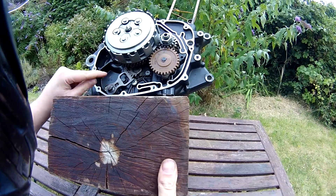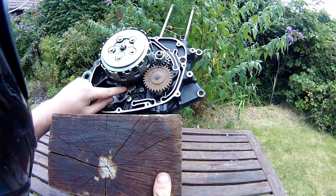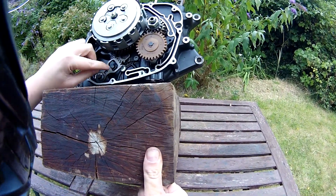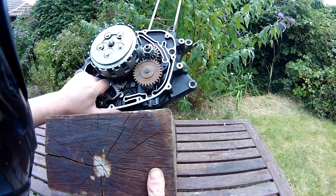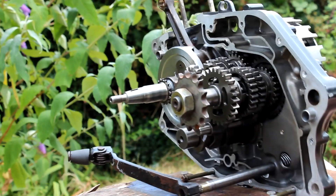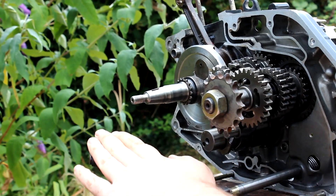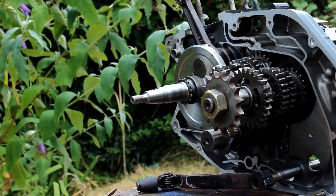The dog clutches catch on to these gears, but we'll get into that in a moment. This here is your shifter — it goes through the engine. It connects to a little ratchet system which makes it only go so far and then return, with a spring to assist. I'm going to have to disengage the shifter to make the engine shift, because it's very difficult when everything's not held in exactly the right place. You can see the shifter goes down and up.